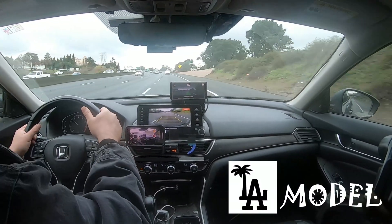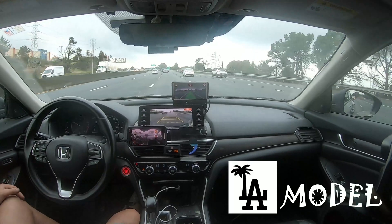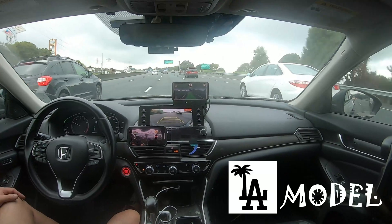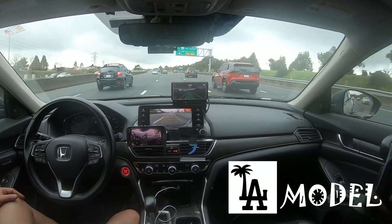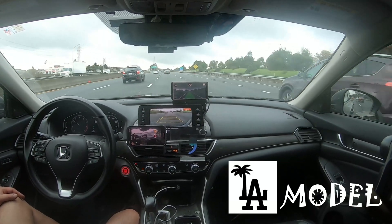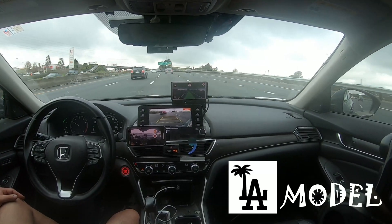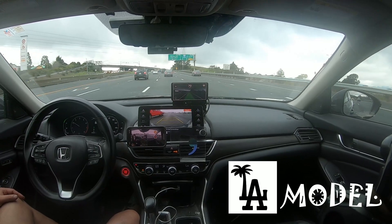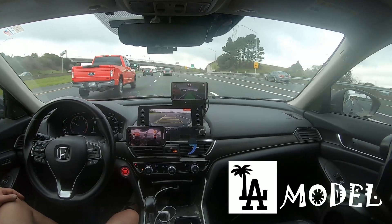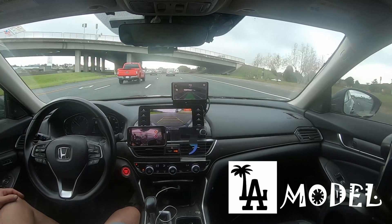I did my 30-second live parameter deletion. Basically, the live parameters that the learner uses — it's a folder with tire stiffness, steer ratio, and the angle offset. Every 30 seconds, that folder gets deleted and then it recreates again, so it starts learning within a 30-second limit. It keeps learning every 30 seconds.